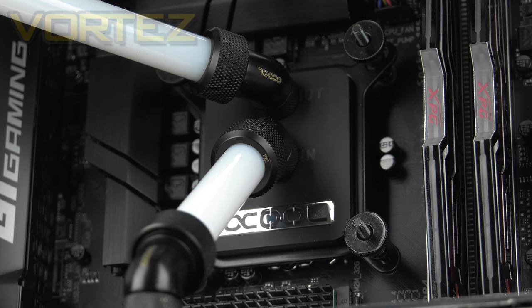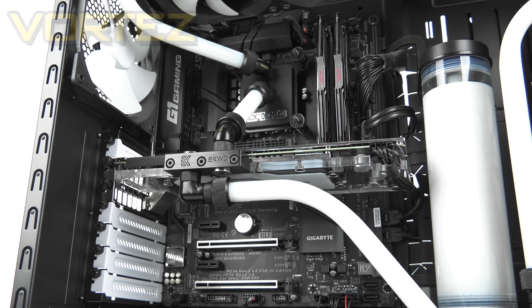Okay, so underneath that CPU block, we have the driving force behind Dragon Shield. It is the Intel Core i7-6700K, which is quad-core and has been overclocked there from 4GHz up to 4.6, and that should increase the overall performance quite significantly. And that chip sits on the GIGABYTE Z170X Ultra Gaming.